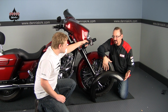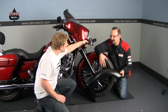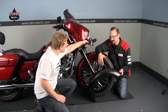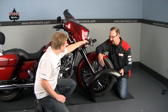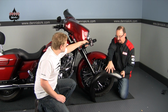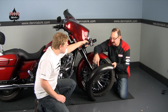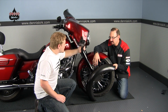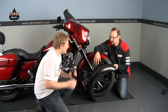This is the best sheet metal in the business, period. The black coating you see on it is called electrostatic or E-coat. It's a corrosion resistant coating, so even if your fender does get chipped from the top or the bottom, certainly it's not going to rust. The other beauty is, for a dealer or someone who has it in their shop, when you take it out, your fingerprints aren't going to rust it right away, and you don't have all the ridges. This is the best quality sheet metal stamping in the whole U.S. So between the long life and durability, the painters themselves, when they get this piece, are going to love it.